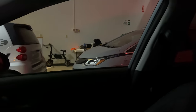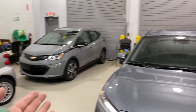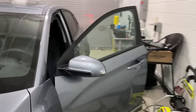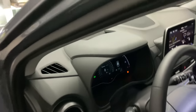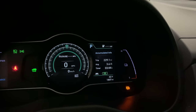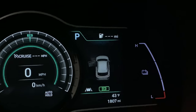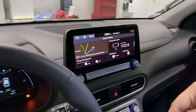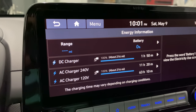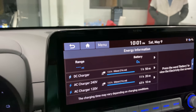A half a mile longer than the Chevrolet Bolt EV updated for 2020. No range test is perfect — I think I may have done the Bolt a slight disservice by a half a mile. Let's double check the odometer: 229.1 miles and 3.6 miles per kilowatt hour — a hair more efficient than the Bolt. This has a 2 kilowatt hour smaller battery pack. Let's do a 0 to 100% charge on AC 240 volts.